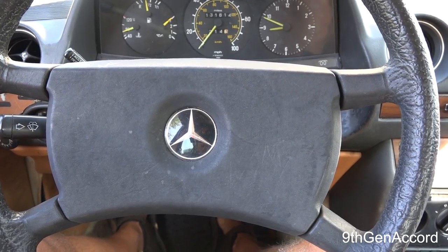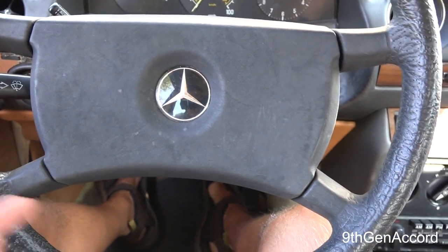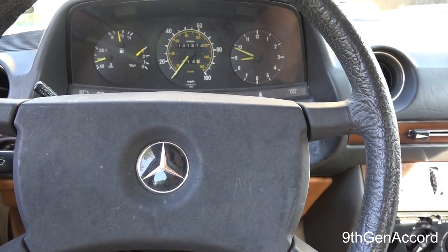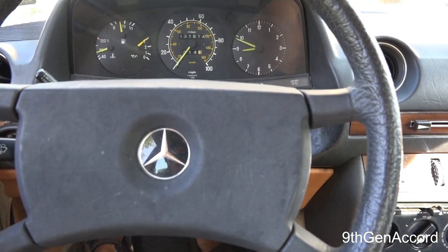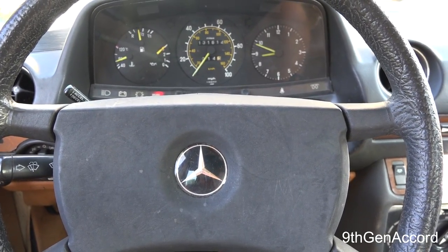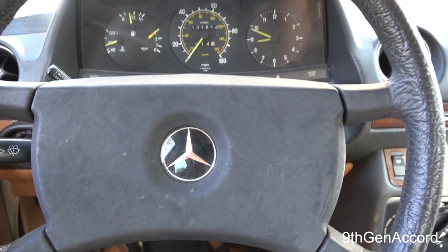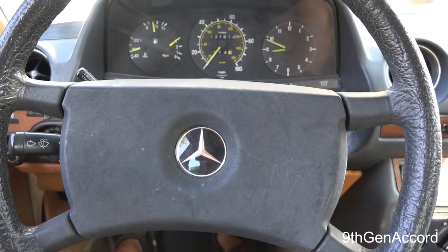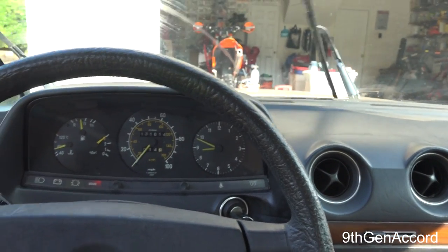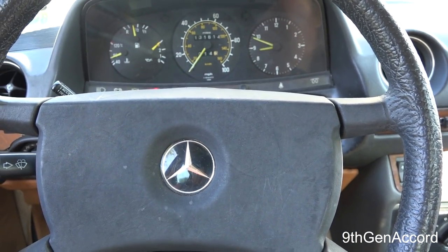One thing I did notice when I was looking at the brakes — because these brakes are horrible — was that the lower ball joint on each side is toast, the boots are busted. So we're gonna have to do a video on that. I had previously done a pictorial on the upper control arms and ball joints a long time ago when I first got the car because it was so bad. I'm really happy that the wipers and squirters work. Gotta clean the windshield better, but guys I hope this quickie was informative and fun.